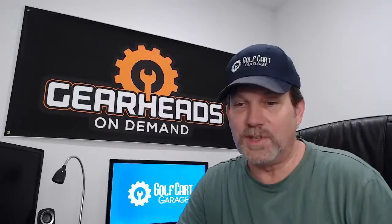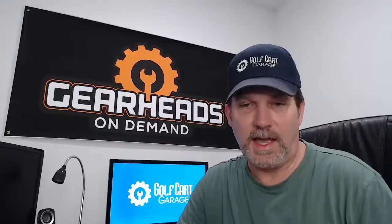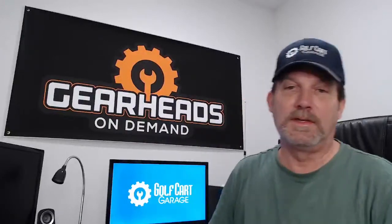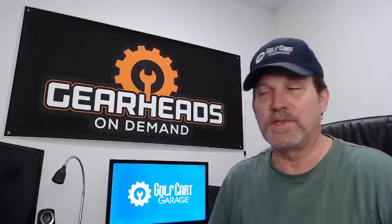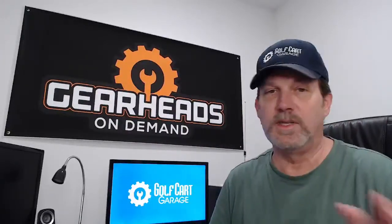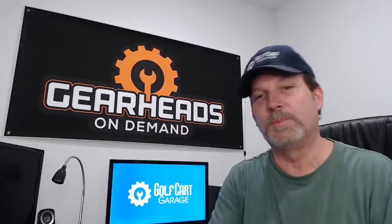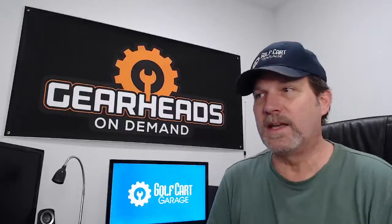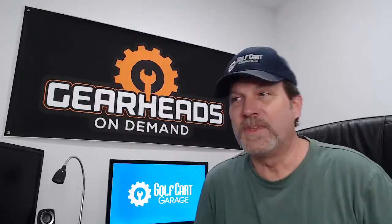Golf cart batteries do not build a memory. They actually would rather be fully charged all the time. They like to be fully charged. They will last the longest. There's no memory. That's some stuff from long ago with older type batteries, even older than lead acid. So lead acid batteries are not gonna do that.